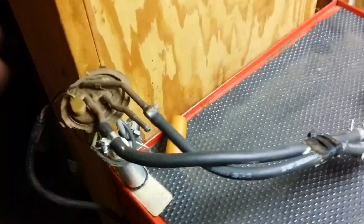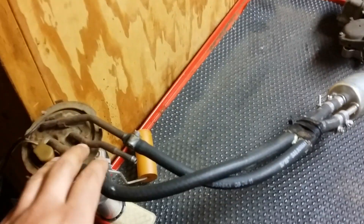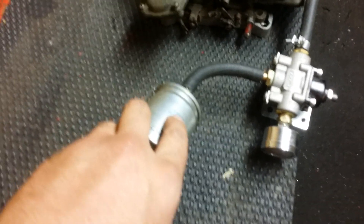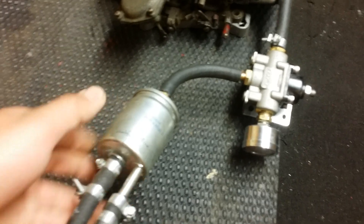I have an override switch — this one I actually used in this car, but I ended up buying a Grand National sender as my fuel gauge sending unit is kind of hokey, as you can see. For presentation purposes this works perfectly. One of these is your vent — I usually run a couple feet of fuel line and put it up by the filler neck.